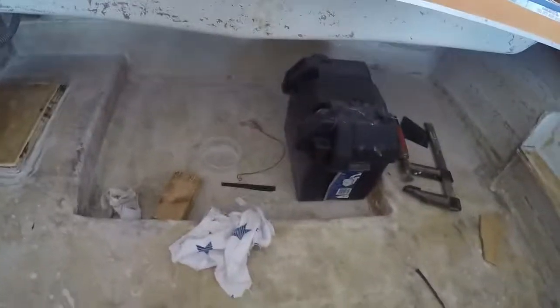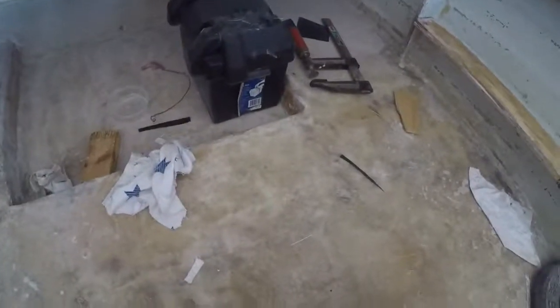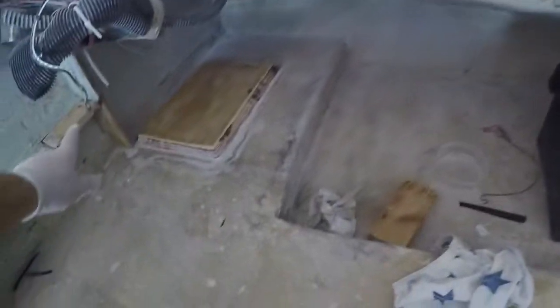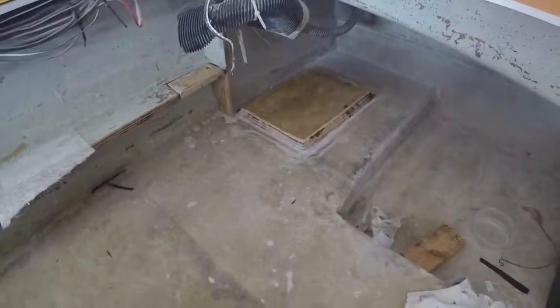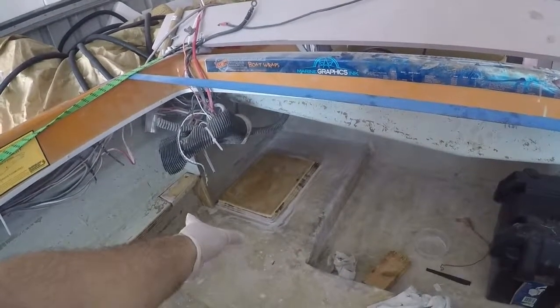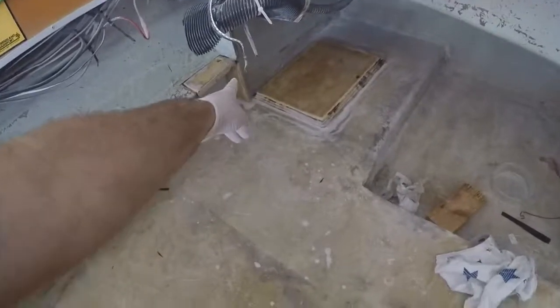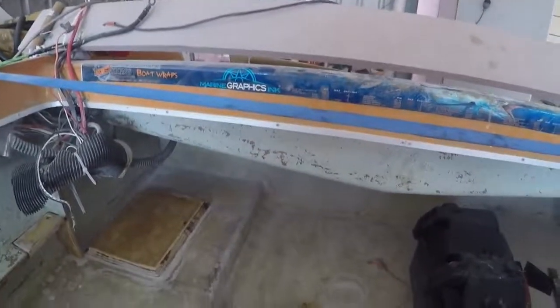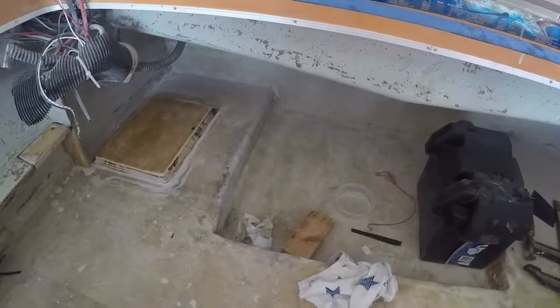Same application - just in there like that underneath. I've sanded underneath, it's all ready to go. I'm going to do my bog first, so I can clamp that on and run a little thin line down there and the rest around there. I'll make a small batch and give that about 10 minutes to go off, because once I bring in the resin and resin these on, it's going to attach with the wet bog behind it so it all will cure off properly.